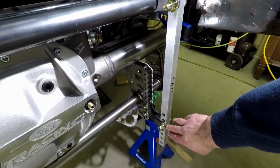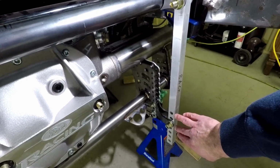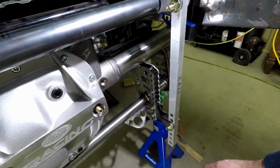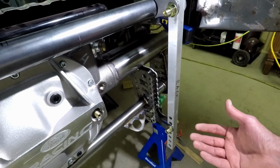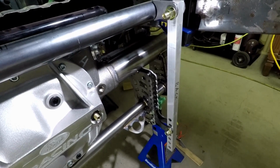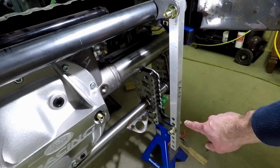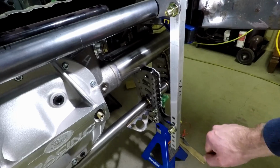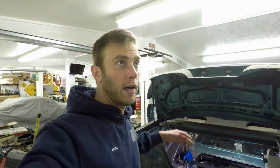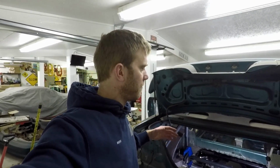I'm probably going to want maybe 2 inches of shock extension for normal ride height. That way I have 4 inches of stroke of extension in order to plant the radials and work on getting out from the dig. But the big thing is having your shock perpendicular to the mounts. The other big thing is working out where I'm going to place the anti-roll bar.